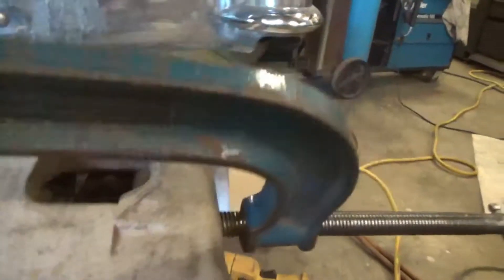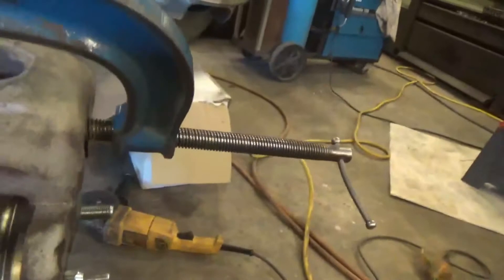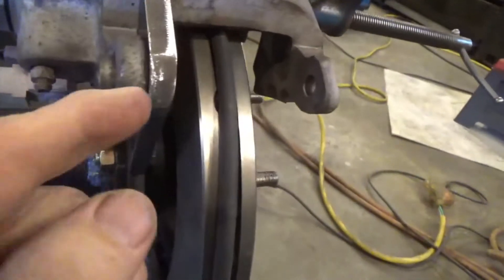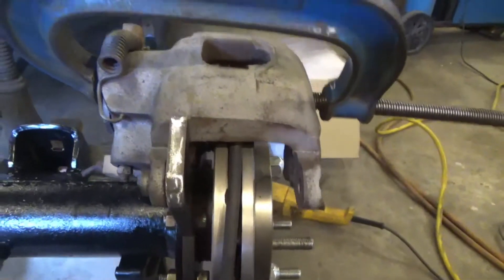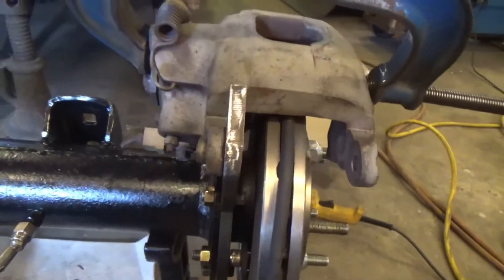I got that line in there. As you can see there's just a little bit of clearance so the caliper will clear and the rotor won't rub. Put a C-clamp on there to hold the caliper tight against this — it's all flush right now. Then I'll just stick a drill bit in there that fits this hole and hit it, and that will put my center points. Nothing will move, so they'll be all perfect. Then take it off, drill it and tap it. That's how I'm getting them square and they will be perfect.